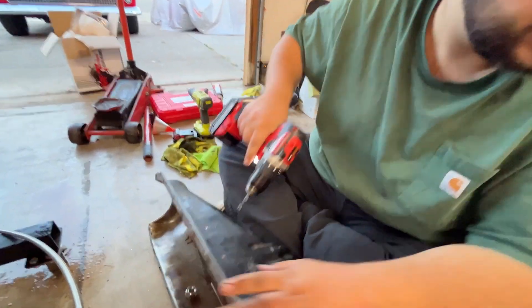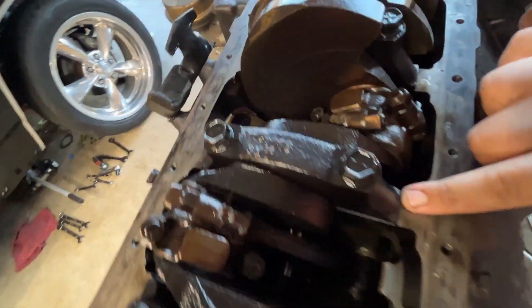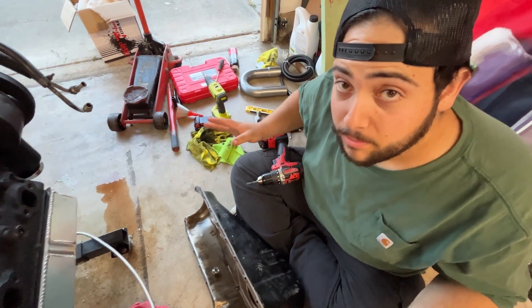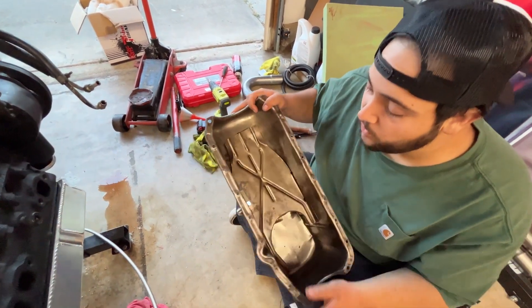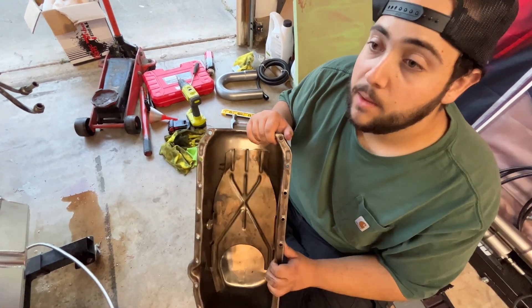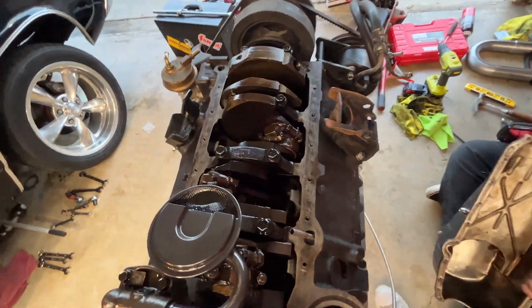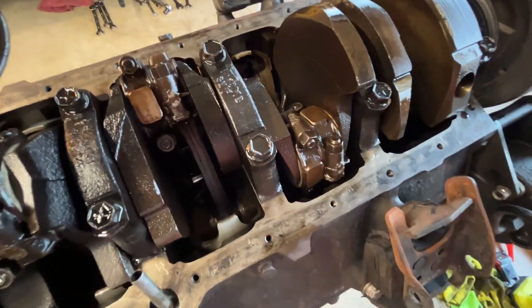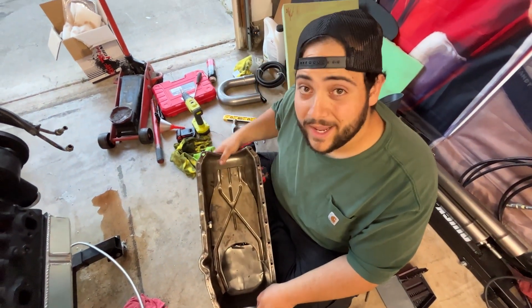We're here now. I'm basically just drilling a hole with the crankshaft exposed — it's upside down. Look right here, you can see this is the main cap right here. That's where we're gonna line up this fitting for maximum fitment. I'm just drilling this one — we already drilled one right here, going to drill the other one right now. We're able to freely spin the motor and see if it hits anything — it doesn't, which is great news. Then we can put this back on, flip it around, plop it right back in the car, and bada bing — turbo time.